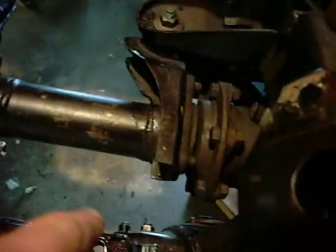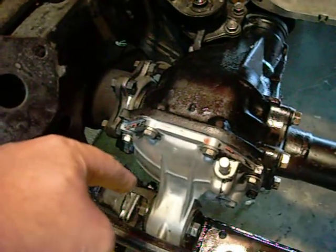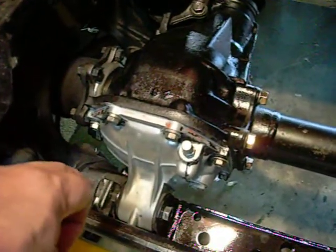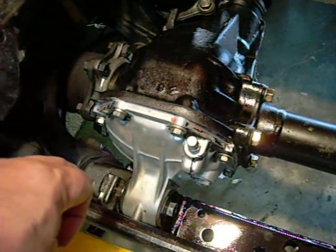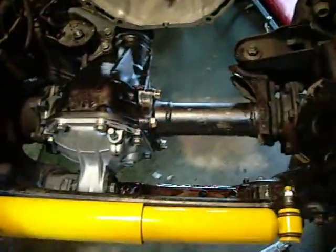It's four bolts, two nuts on the rear. The ones on the dip side are a little harder to get to — just put a closed end on that side and a breaker or something on the other side that can't move, then crack them. I cracked one with a hammer on this side and wound up with this — with a sledgehammer. So just be careful, needless to say.